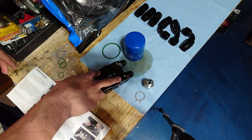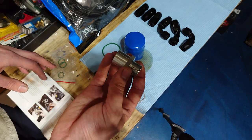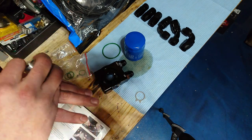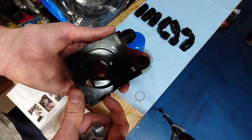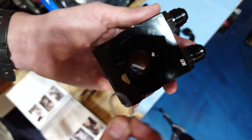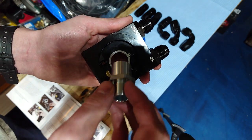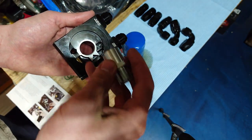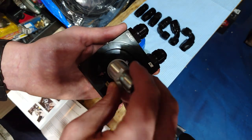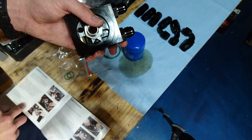It's kind of obvious by now that Vibrant doesn't sell this plate specifically for the Civic — this is a universal fit — but they do a really good job sending you every type of thread adapter you could ever want. There were so many in the package, plus many different types of O-rings and washers, so you could probably make this work with any car. For today, we're going to take this plate and this special washer — you can see that little machined-out portion right there — the tooth on the washer is going to sit right in there. Then we take our thread adapter, which would normally thread onto the back of the block where the factory oil filter threads on, but here it's going to thread onto our Glow Shift thread adapter. That'll keep the washer from moving. You're going to want to torque this thing down to 45 foot-pounds.